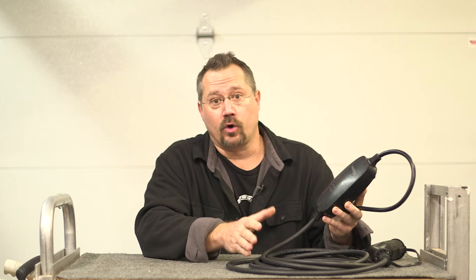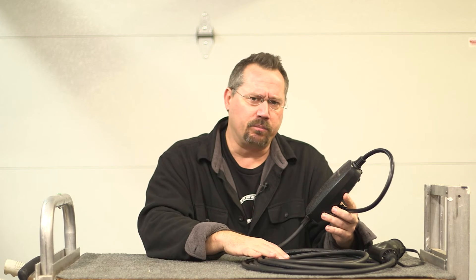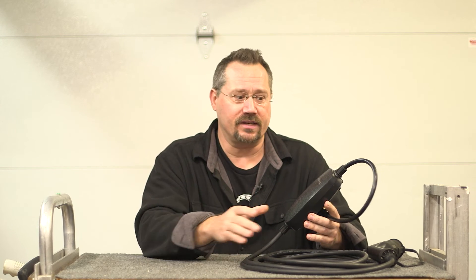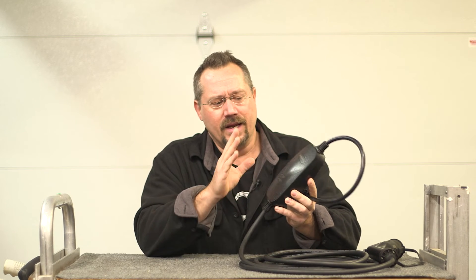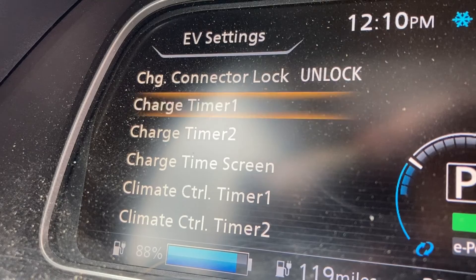Overall, I really like this unit. It's very affordable, it does 120 and 240 volts, comes with a power adapter and a case. It is great as a small portable unit — an extra one you keep around, maybe put one in at work, keep one with you in your car. Now it is only a 16 amp unit, which is great for older EVs and plug-in hybrids. If you have a newer electric car with a larger battery, odds are for your primary charger you probably want a faster EVSE — you're probably looking at 32 amp, maybe even 40 amp EVSEs. The only other thing is there's no special connectivity features — no web connection, no app. Some high-end EVSEs do have those features, but that feels redundant or overkill to me because features like timers are generally built right into the car anyway.